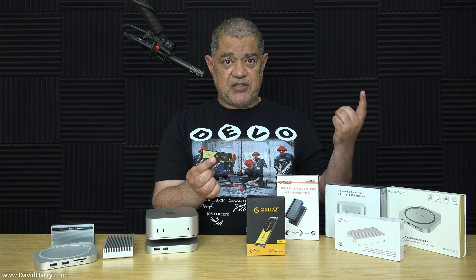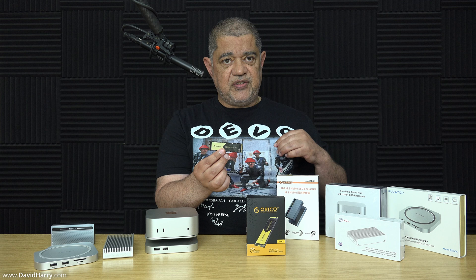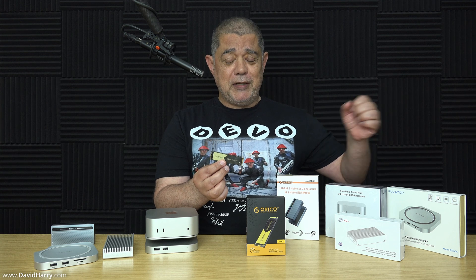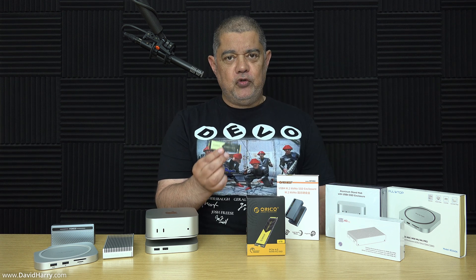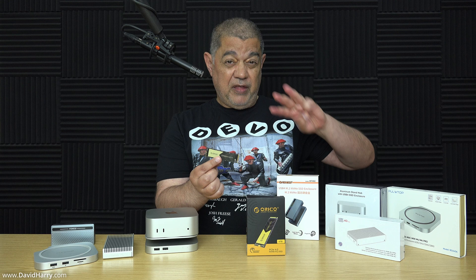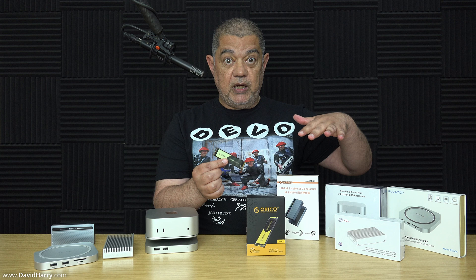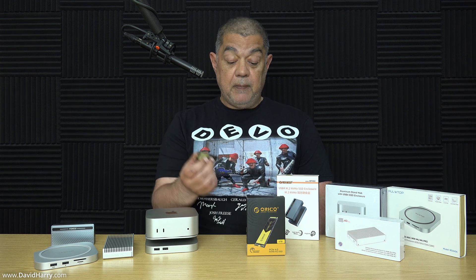What I do in the test is take a 400GB folder for real-world disk speed testing. I write the folder to the external enclosure using the Orico SSD, then without giving the drive time to settle and refresh its SLC cache, I rewrite another 400GB of data. For the first two passes of 400GB it doesn't slow down — it maintains its high speed all the way through. It was only during the third pass of dumping another 400GB that it eventually slowed down and ran out of SLC cache. So the SLC cache appears to be somewhere in the region of a terabyte.